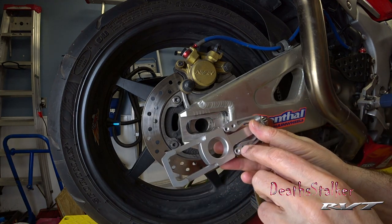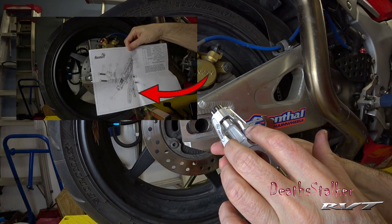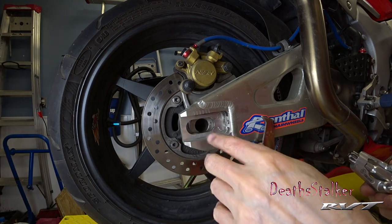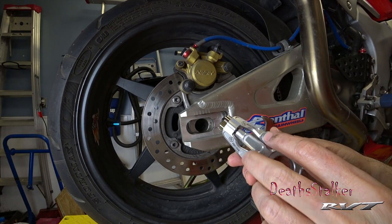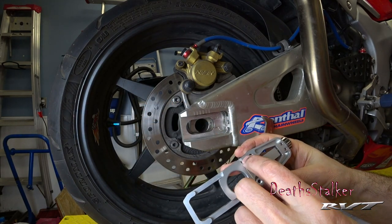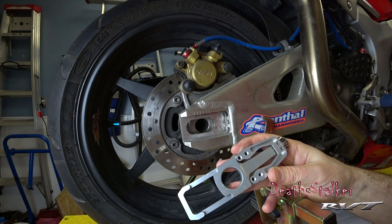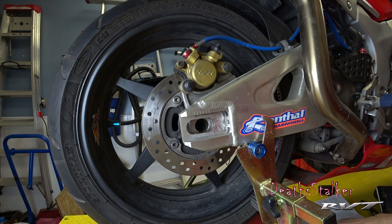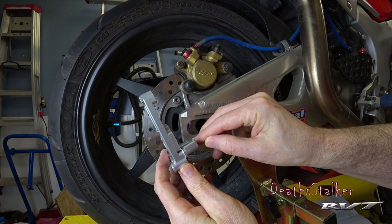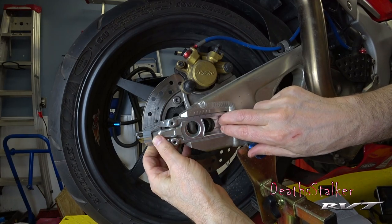On the back here you can see there are two sets of bolts. These bolts right here would be used if you're using the rear stand plate for light track days. I'm using spools so I didn't bother ordering the adapter plate. The bracket that locks this onto the back of the swing arm uses these two bolts here — make sure you don't confuse these for the backing plate bolts. When I slide this in, the backing plate has some little hooks to grab the back side of your swing arm, so once everything's tight it will be good and stable.